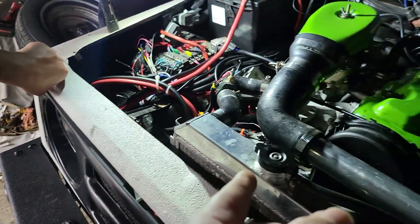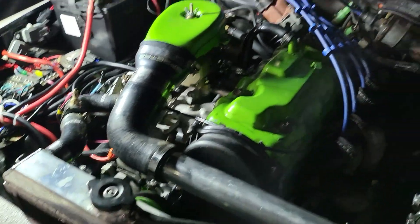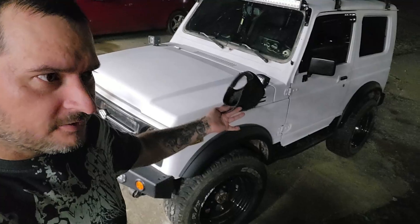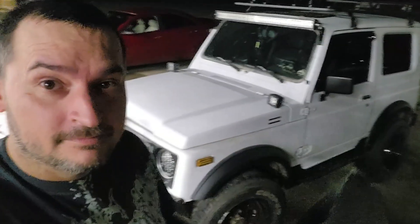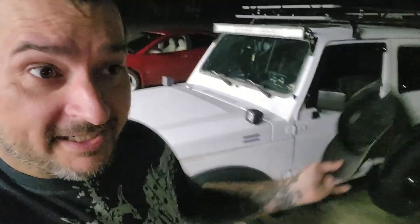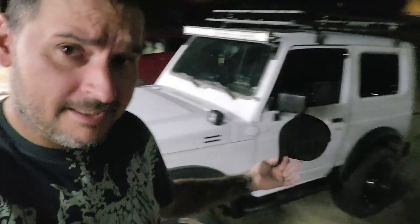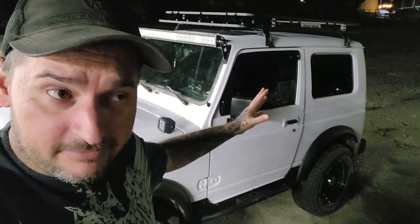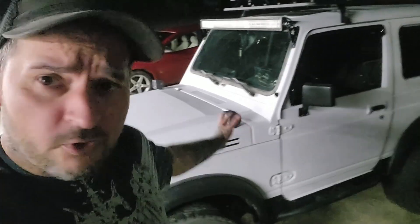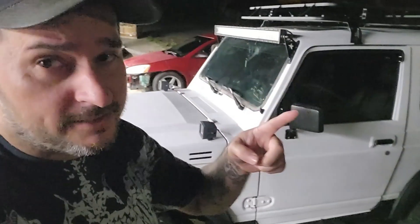Either you washed your hands in gas or that oil is saturated with gas. That's the Samurai — the Sniper's got to figure itself out. We need to test drive it. There's a little chatter when it gets warm — that's probably a main bearing knock. The gas in the oil is making it thin. We'll give it an oil change. We need to get the Sniper ready to figure itself out. All in all, it should be a good little wintertime Samurai. A man can get these motors pretty cheap, have one built up and ready to drop in. Thanks for watching — subscribe, check the eBay store out, see you next time.